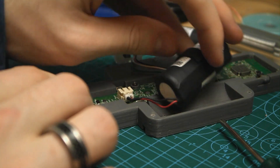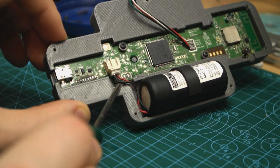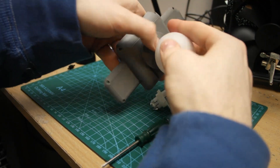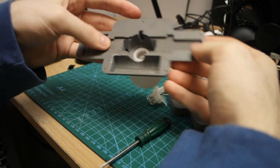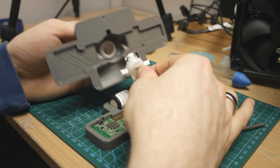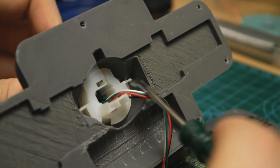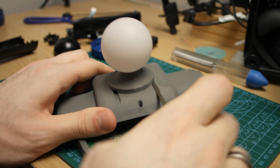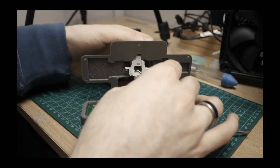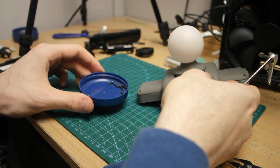Next, plug in the battery, place it into its compartment with the more egg-shaped point pointing down and outwards, and route the cable through the channel to make sure it doesn't get pinched when you screw on the top later. Next, grab the top half of the custom case, then grab the bulb from the old neck of the PS Move controller, take it out and push it through the hole in the new lid — it should lock in place just like on the original controller. Then carefully grab the LED assembly and slide it up into the channels on the top half so it goes into the bulb the same way it was on the old controller. Make sure it's butted all the way to the top, then grab two more screws from the old controller and screw them into the channels on the neck of the top half to hold the LED assembly in place. All you have to do now is put the top and bottom halves together and use the rest of the leftover screws to close it up.